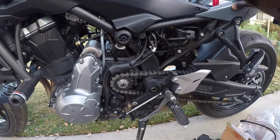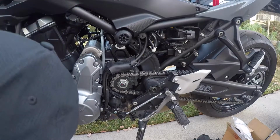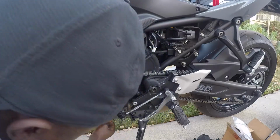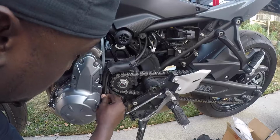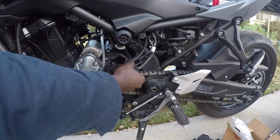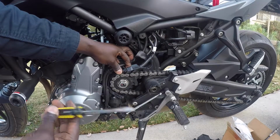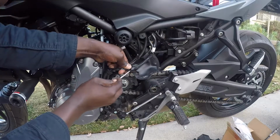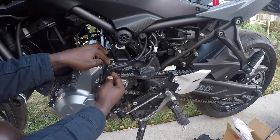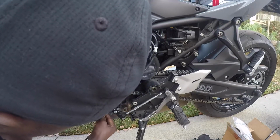Now what we have to do is follow the cable for the O2 sensor. This is it right here, it comes from here. Yep, this is it. What we are going to do is just disconnect this. This is where the flat screwdriver comes in. Right there. All right, so you follow the cable. Goes here.